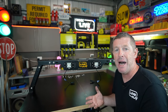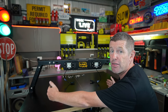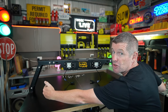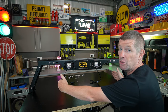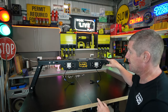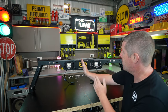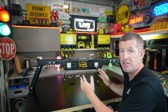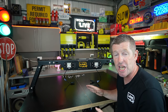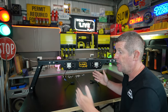I should have probably said this earlier, but it makes sense to check the center-to-center of the tracks you're mounting this in. In the case of a Next-Gen Ranger, it's around about 1375mm from track to track. This setup works perfectly fine — we need to adjust the legs out just a little bit but it will slot in perfectly. Working out from the middle, I'm using the second and third slots, giving us adjustment on both sides to work with the slotted tracks in the roller shutter on a WildTrack. If you're putting this on a PX WildTrack, they're slightly narrower, so adjust accordingly.